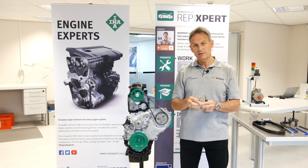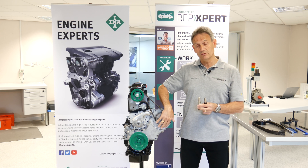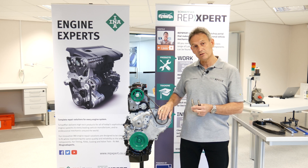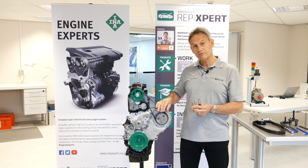The change frequency is the same for the timing belt and for the chain or the belt in oil — it's 125,000 miles or 10 years for the Focus and Mondeo, and 150,000 miles for the Transit Connect.